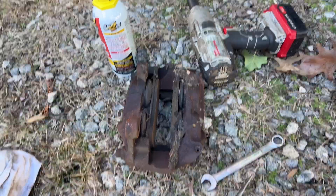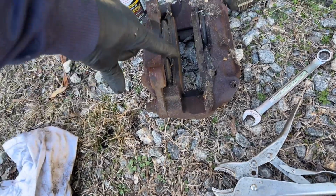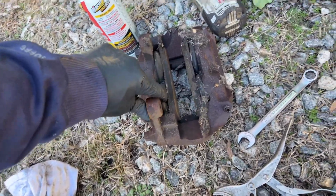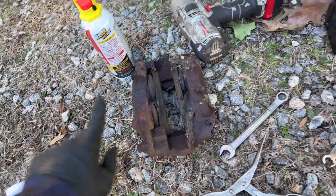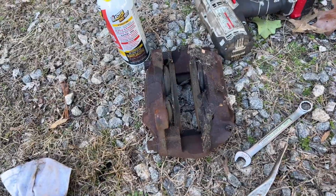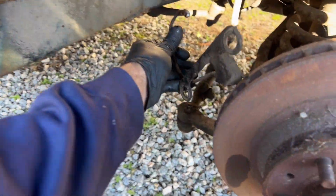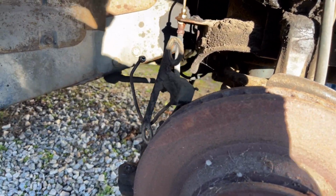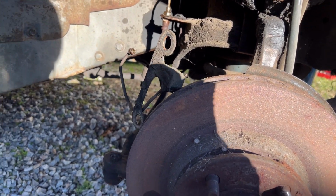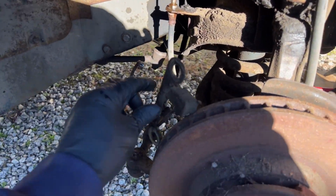We'll see. I guess I'm kind of glad my hand is being forced, because now that I have this other one off on the passenger side, I noticed the rubber boots are actually broken. So this wouldn't have been good to try and use anyway. I also noticed on this side that the safety wire was not in place, so somebody has had this one off before. Who knows when, but anyway, like I said, I'm going to be replacing. This one was not plugged up. You can see the fluid was definitely getting through it, but I don't know why I wasn't able to get the brake pedal to build up, although it was starting to build up pressure the last time I pumped it up, but that's irrelevant at this point.